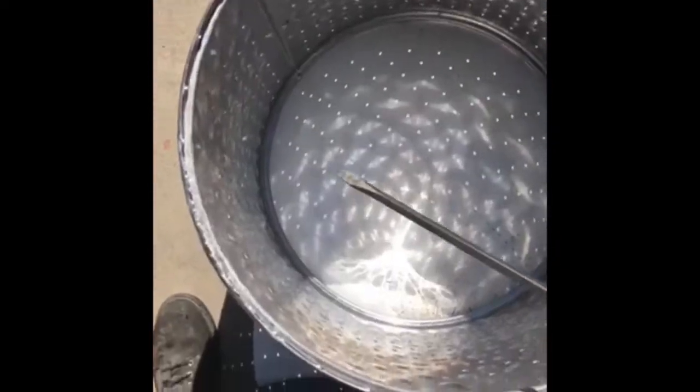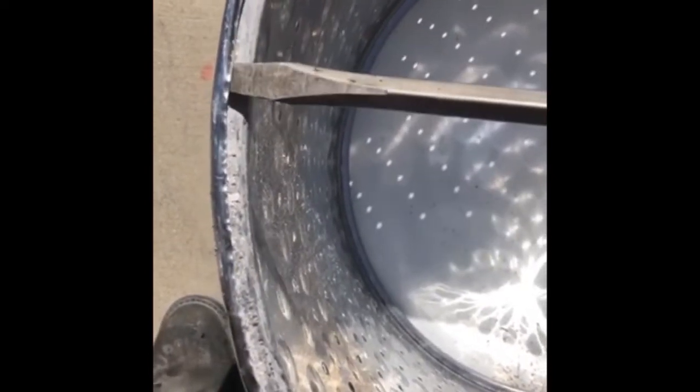Alright, that's enough practice — time to just get to it. It's pinched in some parts so I gotta get rid of the pinches, pop it out a bit so that it makes contact with the metal while I'm welding it. There we go, just like that. It's coming along now — I got it spot welded in place.